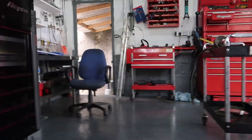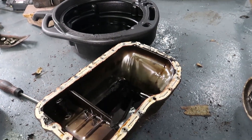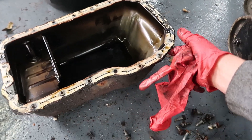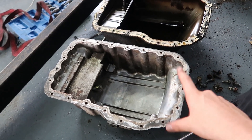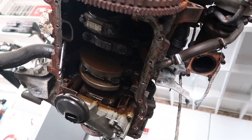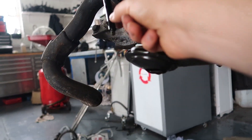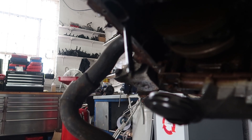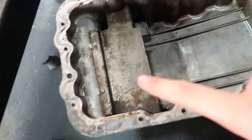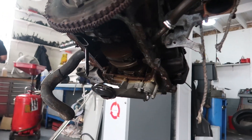That's the sump out. I'll grab the 1.7 sump which I'm just cleaning and degreasing, and test fit it — not sure if any modifications are going to need to be made. Here's the new sump, all cleaned and nice. Going to clean up the bottom seal, put some gasket sealant around there, and bolt it up to the bottom. I think we're going to get rid of this oil level sensor, because my car has nothing to display that anyway and my new sump doesn't have the hole for it. So I'll just snap that off and get this one on the bottom.